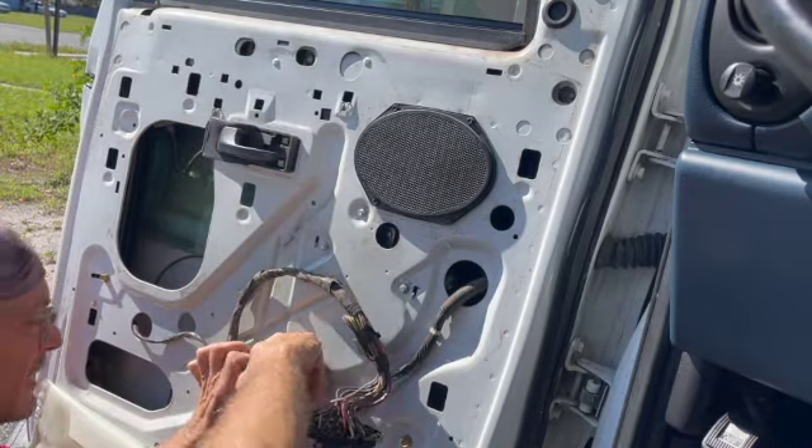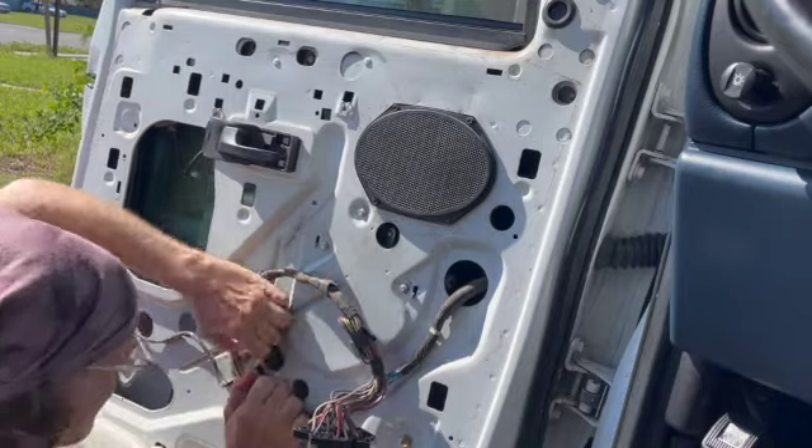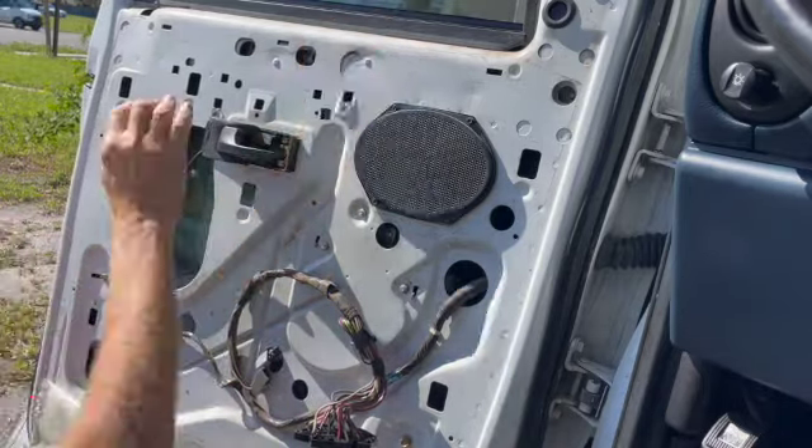This has been done before with an aftermarket part, and when they did it they didn't put the rivets back in, which is fine. If you need to, you can use quarter-inch nuts and bolts. Normally, to get the rivet out, there's a center point — you bang out the mandrel, the center point, and then you drill out the rivet. But in this case I'm just taking out bolts, and I'm going to rivet it back in place.